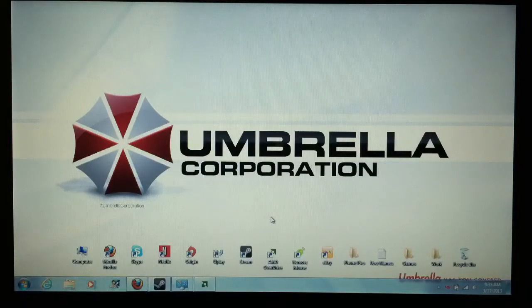With the 7640G, I had 4GB of RAM that came stock with it — 1333MHz. I upgraded to 8GB of 1600MHz RAM at Fry's Electronics for like $48, and this laptop went from nothing to something real quick. So if you have anything less than 8GB of RAM in this laptop, go out and upgrade. It's a cheap upgrade — skip a couple McDonald's meals and upgrade the laptop and start doing some gaming.